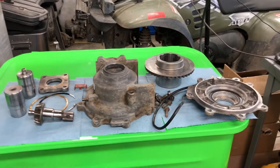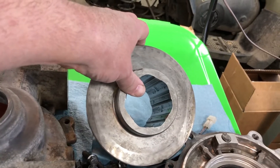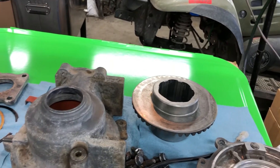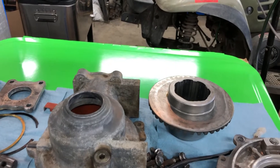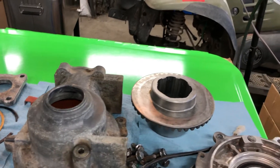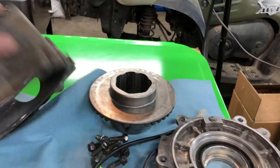We're back at it today — pretty sure we're going to finish this up. Everything's cleaned up and fixed as best I could with the emery cloth and wire brushes. The inside of this ring gear didn't fare as well as everything else, but I think it'll work. I looked up a used one — it was like a hundred bucks and I just didn't want to spend more. I found one out of a 400 — the ratio's the same — and it actually had the cage, the rollers, and the hubs. It was like $240. So if you're looking for one, there's one on there — it's got the hubs, cage with rollers, and the ring gear, out of a 400. They're the same other than that one has the big bearing and this one has that red colored bushing.